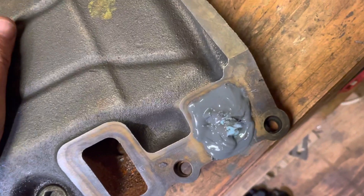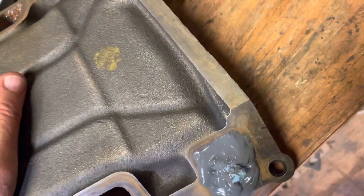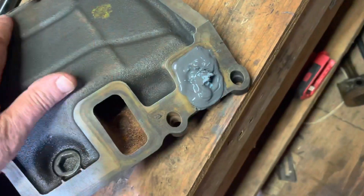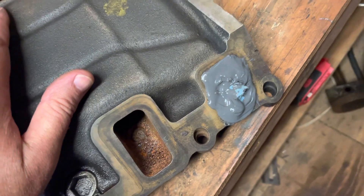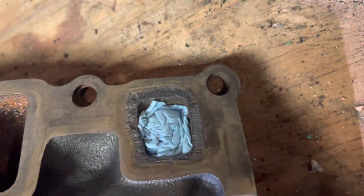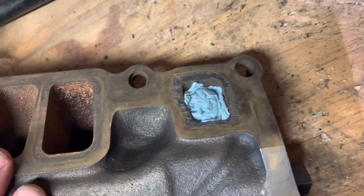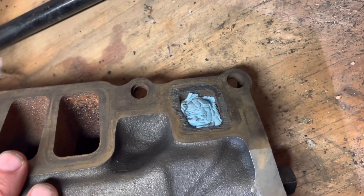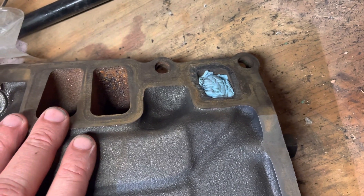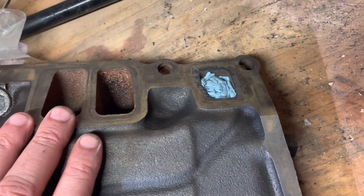What I do is I'll lay a gasket on top of it, and then I match the contours — you have to sand it flat with the surface first, and then you match the contours and grind it out with a carbide grinder. I've done this before on another manifold and it fixed it. You put a rag in there to keep from wasting a lot of your epoxy. If you don't put the rag in there, epoxy will flow down in the hole — you can get it out, but it wastes your epoxy and it doesn't go where you want it.